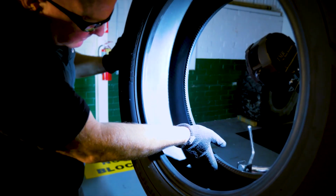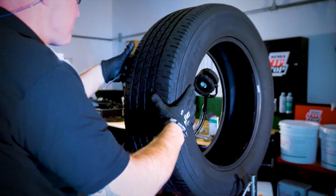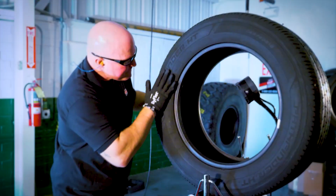The Minicombi repair unit can be used for truck, light truck, and passenger tires. It is mostly used on passenger tires, as you will see in this demonstration. It is important to check every tire for run flat condition and secondary damage. Check the inner liner, the outside tread area, and the sidewall.